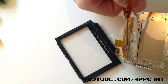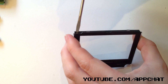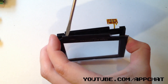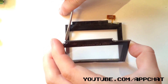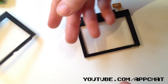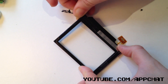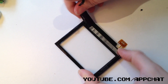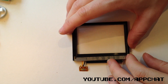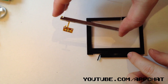It was just stuck with a little bit of tape or glue. Now you can cut this piece here — and this is rubbish. Use a flat head screwdriver to detach the Game Boy Advance SP piece from the other part of the screen. You'll notice it's just stuck together with some sticky stuff. The part with the logo is now rubbish. Now we need to get rid of all the black sticky stuff — the easiest way was to get the corner up and then peel it all off. Scraping it off failed. Once you've done that, the actual backlight piece should just slip out of that black casing — so gently take it out.